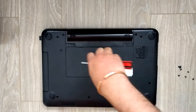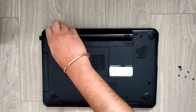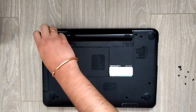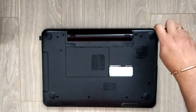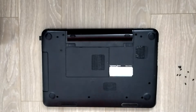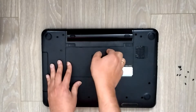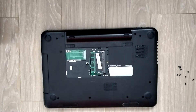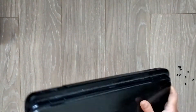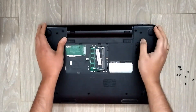The reason I'm doing this is that for Dell laptops, at least this model, the DVD-ROM caddy slot is not bootable - or it is technically bootable but it doesn't seem to boot the OS from the SSD caddy. So I had to put the SSD back into the motherboard slot so that it becomes a bootable drive.